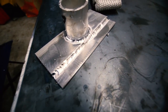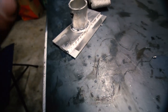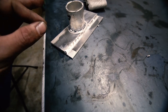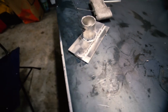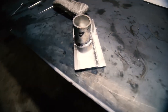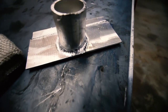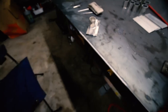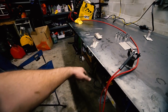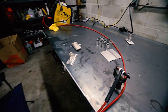I've been doing a little bit of aluminum TIG welding. I'm getting there, still not quite there — it's tough. To get the electrode right, you have to be really close so it doesn't just melt everything. But when you're that close, if you dab a little too much rod in, you blow it right into the tungsten and duff the electrode. I'm happy with that though. Definitely need more practice. Hopefully by the end of this practice material, I'll be ready to weld the expansion tank for the Miata.